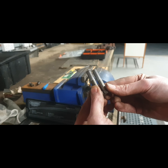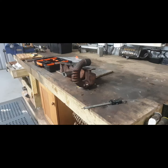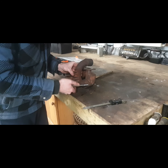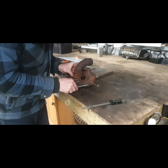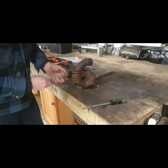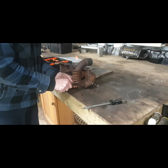Need to go a little bit more on this one — that's no panic at all. I'll come back with that done and show you threading them into the manifold. I can use the old u-bend as a template to give me an idea of how much thread I need to cut on these bolts. I will be putting washers — it's just nipping up nicely there. Best to not fit them for this test to make sure there's definitely enough threads to tighten up completely.